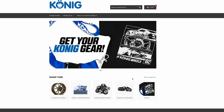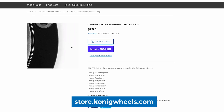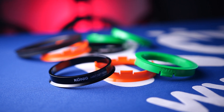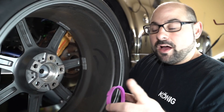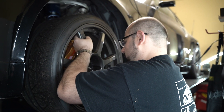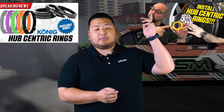If you guys need to order any replacement center caps, we got you at store.koenigwheels.com or visit any of our retailers. Now let's talk hub rings. We've done a few detailed videos breaking down the term hub-centric rings and exactly how and why you should use them, but here's a short version. Hub rings are used to center your wheel onto your vehicle's hub upon installation. Their purpose is to perfectly center your wheel, which reduces vibration of any kind and improves ride comfort. We make hub rings for all of our wheels in various sizes for a multitude of vehicles. We'd recommend using plastic hub rings for street applications and metal ones for track use. For more details on hub-centric rings, be sure to click on one of these two videos.